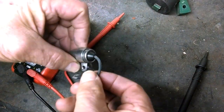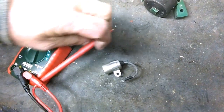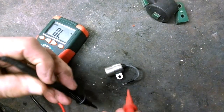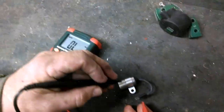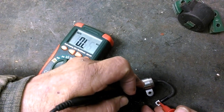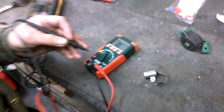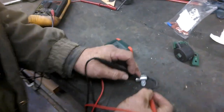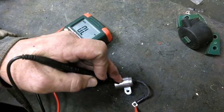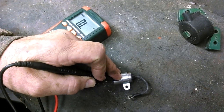To show you how to discharge it, I'll do it again - it should climb up again. I've discharged it, now I've recharged it, and I'll test the leads again. This time it didn't stay charged - so maybe this condenser isn't holding.